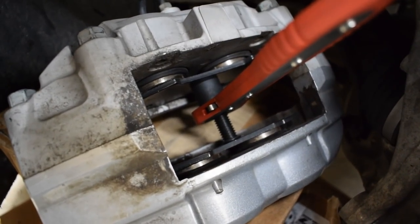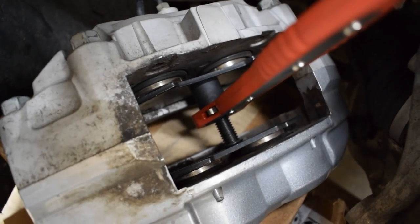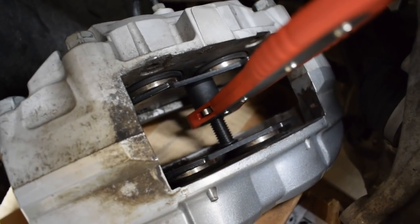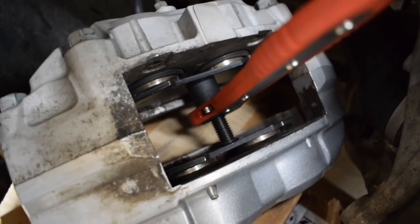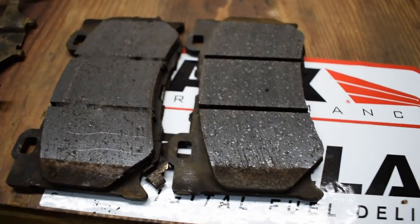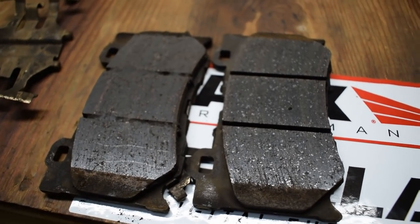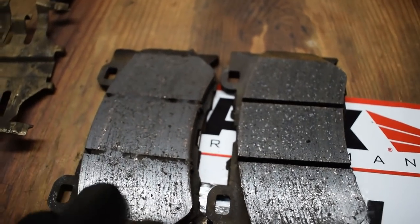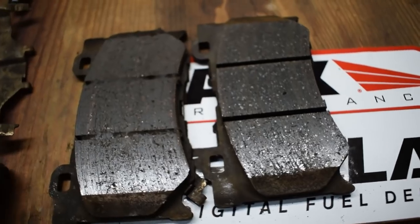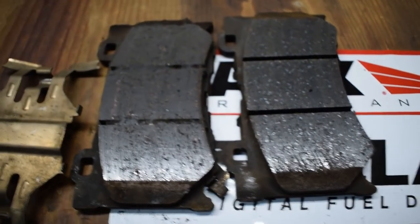This is probably one of my favorite tools in the garage — the piston retract tool — and it fits perfectly inside my front calipers. I'll link it in the description. Make sure you use the proper tools to retract these pistons rather than a C-clamp. The pads were wearing pretty even; some people say the inner wears faster than the outer on these cars, but it looks fairly normal overall.